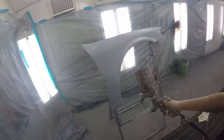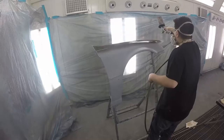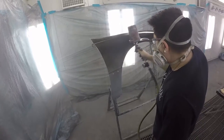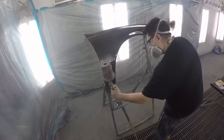You don't want your regulator in the red — you always want it in the green. You can push it into the red a little if you need to break up the material and avoid orange peel when spraying. Since we mixed it with some urethane reducer, it's going to turn out really wet and really nice. Here I am using that robotic attitude — right to left, left to right.